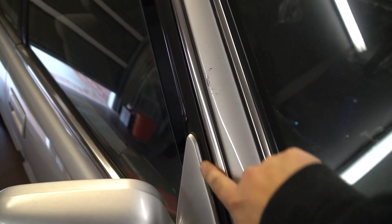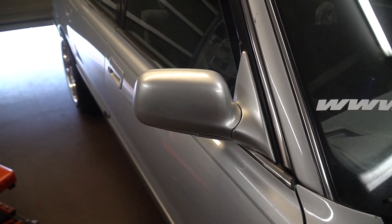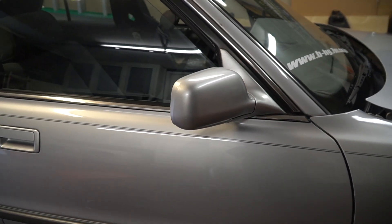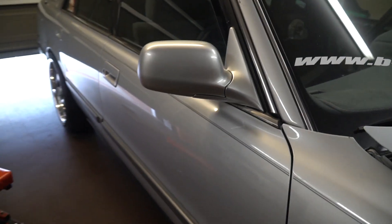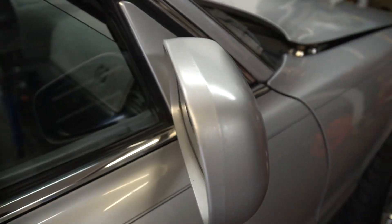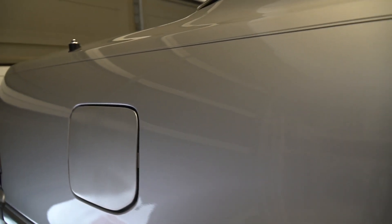It's been a couple of hours. I used a heat gun to help the paint dry a little faster, then went ahead and reinstalled one of the mirrors and the gas tank cap. I masked off the black rubber molding so there's no overspray on it - looks good and the color matches. The shine isn't quite the same as the OEM paint, but I have to wait a week before I can cut and buff them. The gas tank cap's the same way - the paint doesn't look too even, but once I cut the eggshell finish it should blend pretty well with the rest of the car.